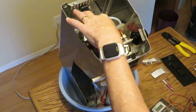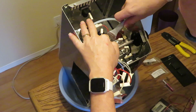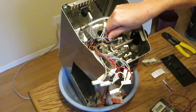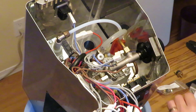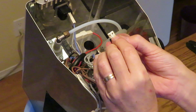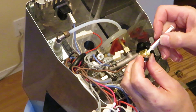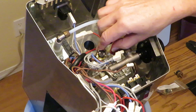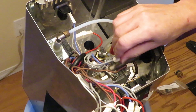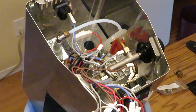I'll start with the easy one since I have the two connectors off already — and my main suspect. As you can see there's a little remnant of thermal paste, so I'll just get rid of the old stuff. It's stamped 145 right here. I'm going to add a little thermal paste. Make sure you buy the right part — these are M4s. I'm just going to do it hand tight, because it's a brass connector it doesn't need to get really super tight. So that's the first one done.